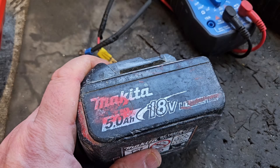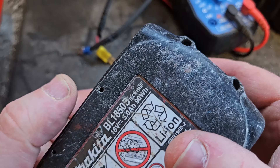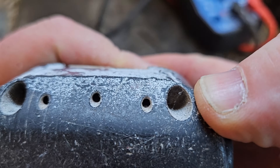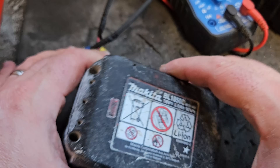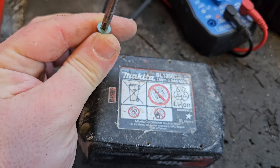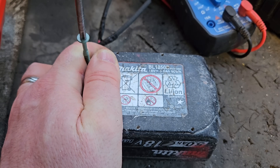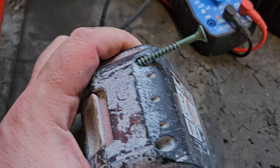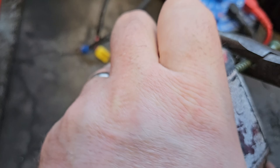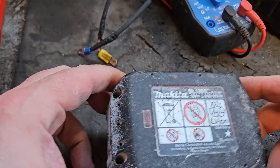Without any further diagnostics, you have to get the battery open. There are four T10 screws holding it together, but down one of the holes you have a little blanking plug — it's like a security tab. Makita and Bosch have these. I'm going to remove it using a wood screw — just screw it in, wiggle it out, and use a pair of pliers if needed. That's the security tab there, that little white bit. Now you have access to all four screws.